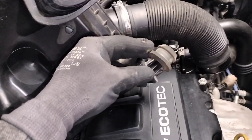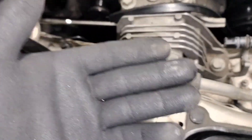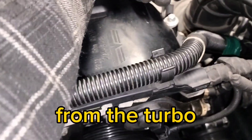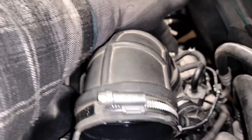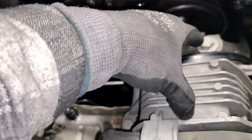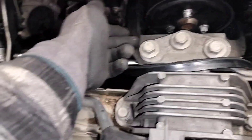The air box is really easy to remove — it doesn't have any bolts on this type of vehicle. They just sit on this rubber mount. We have to pull it up, then disconnect this hose over here and disconnect it from the connection. I tried to do it from the connector on the bottom but it was really hard, so I ended up doing it from the top. Next, we're going to support the engine from the bottom and remove the engine support bracket.